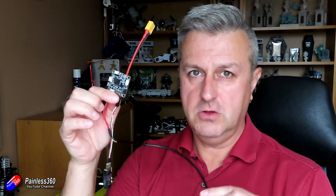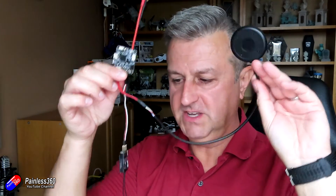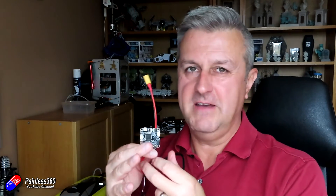I'm adding this because I just want to see what it's like. I want to put FPV on this boat — the idea is me and my buddy can chase each other. I like the on-screen display showing battery voltage and flight time, though some of those terms don't really work for boats. All that information means I can make sure I don't ever leave my boat stranded. I'm going to use a very cheap and cheerful flight controller: an Omnibus F4 Pro, which will also let me monitor current. Plus a cheap GPS unit, a little S.Bus receiver, and a camera and video transmitter.